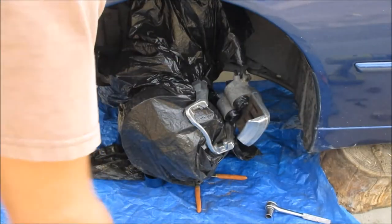I'm going to go with one light coat, then wait about 15 to 20 minutes before applying the next coat. I'm only going to do two coats because I need to save some paint for the caliper on the other side, and two coats should be enough for both calipers. Make sure you shake the can very, very well before spraying.